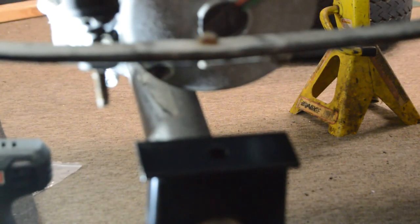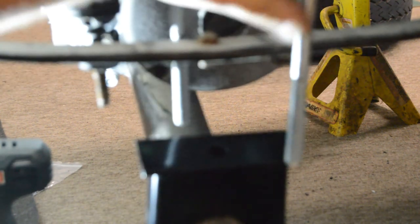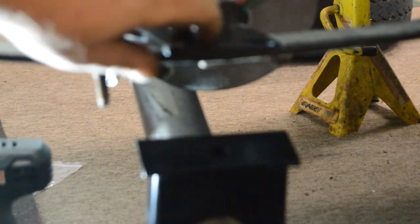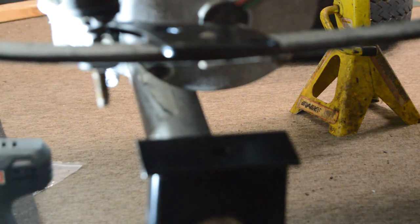This is going to end up going over that at an angle — the front prong goes in front of the axle and the rear prong goes behind the axle. I forgot our shock plate — where the shock is going to mount through — because the original shock plate will be down here so that won't work out.